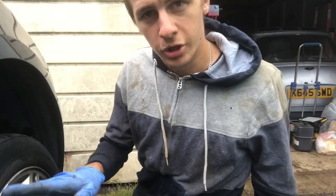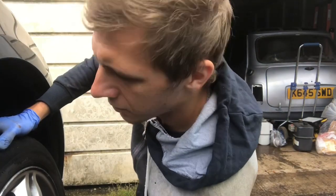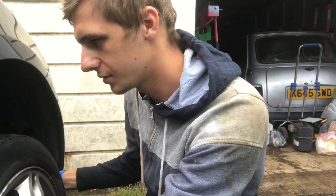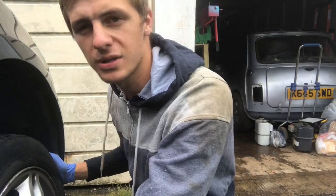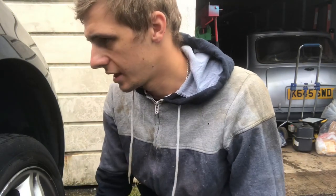I'm not going to torque it up just yet because I'm going to wait until it's back on the ground. But the wheel's on tight enough and we've got the wheel checked top and bottom — there's no movement there. Side to side you will get a bit of play — you've got a bit of slop in your steering rack so you will feel a little bit — but if you were sitting here and it was knocking with a lot of play, that's when you need to start looking at your track rod ends. That's all done on this side.